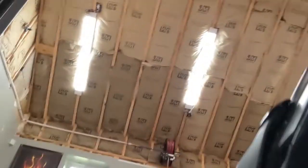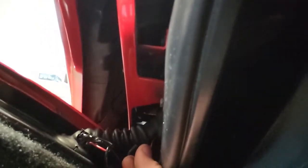But most of the time the wires in between the door are the culprit. As you can see, somebody else has already been in here, cut this, and actually tried to butt connector this together. The red wire in here is actually the signal wire for the actuators. So I have to come in here, re-solder it, put a new piece of wire in there, and get that all fixed up. Then the door actuators will work, the handles will work, and everything will be back to normal.